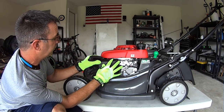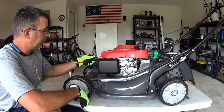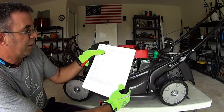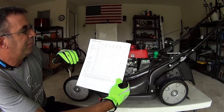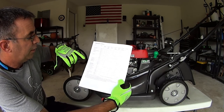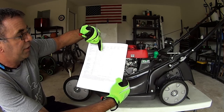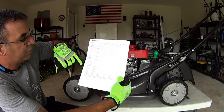This just clips on here and we're done. The spark plug is right in the front here with the boot — easy to get to. You don't replace the spark plug for a while. The Honda manual comes with a nice maintenance schedule broken down for you. Before each use it tells you to check the rear shield, check your blades and blade mounting bolts, check engine oil, and put gas in. After five hours of use or the first month, go ahead and change the oil — which we already did. Also at five hours: select drive cable adjust, which we'll follow on page 13.